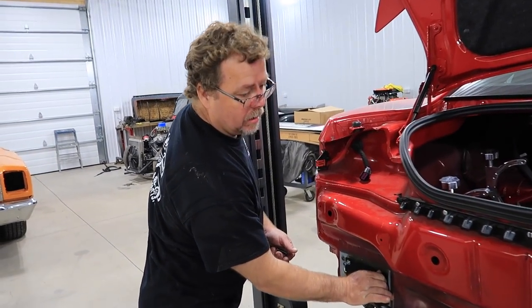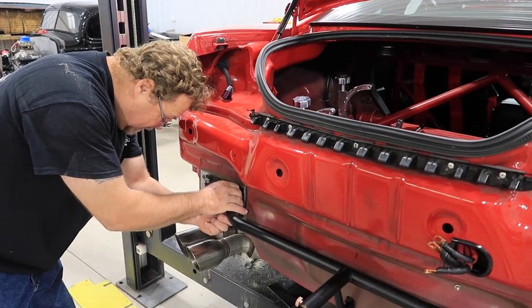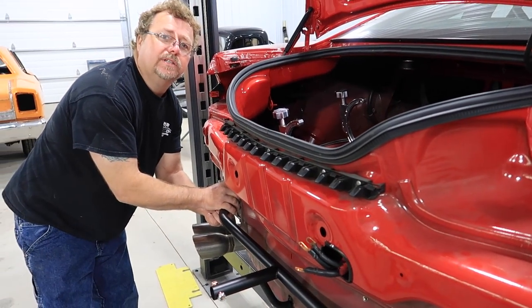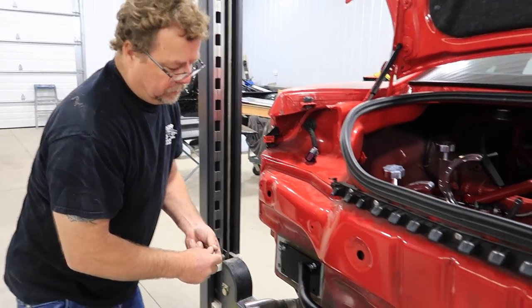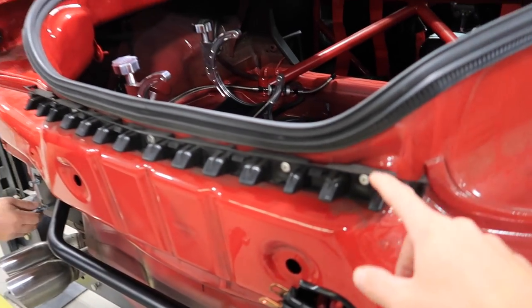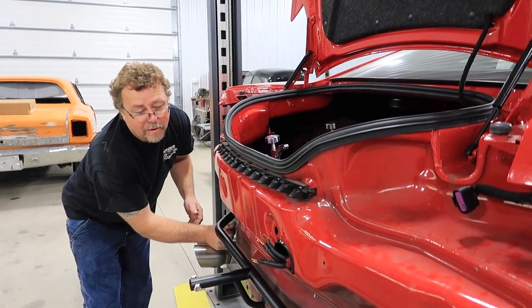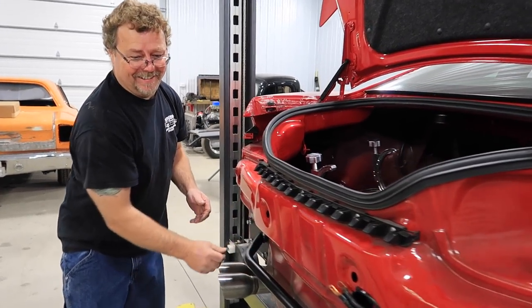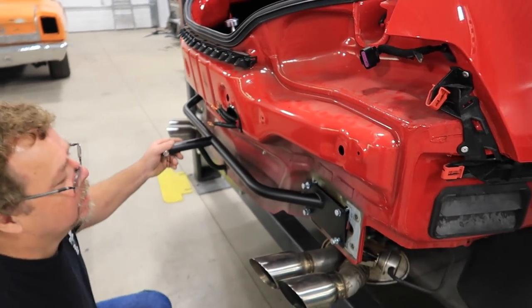There's so much safety stuff from the factory and so much stuff that wasn't in the older cars. Because they are that heavy, when you put a cage in, you don't have to put rocker bars and stuff. It's good structure. All this stuff adds up, this plastic stuff everywhere that wasn't on older cars. If I was going to build a 5th gen, I would use the shell. And a lot of it's sound deadening that I found, a ton of sound deadening in a car.